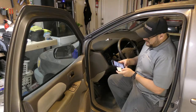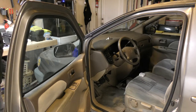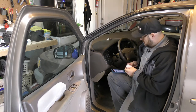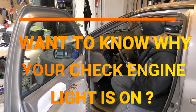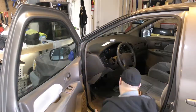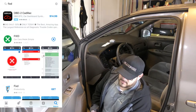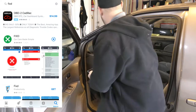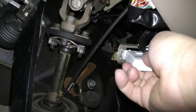There's an installation guide in the packet with instructions. Step one is to download the Fixed app on your smartphone, and it suggests to not open the app until step four. Step two is to make sure your phone's Bluetooth is turned on. Step three is to turn the vehicle on and leave the engine running for at least five seconds before opening the Fixed app. Step four is to open the app and register for a new account. Step five is to input the code on the back of the sensor into the app. Now we're ready to plug the sensor into the OBD2 port, commonly located beneath the dash.